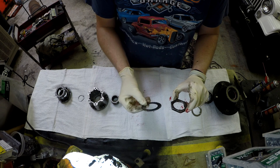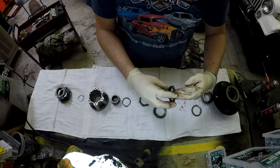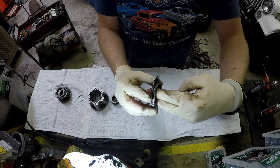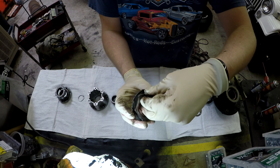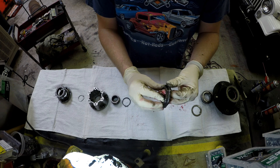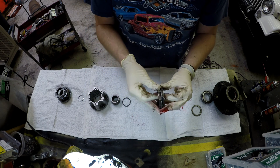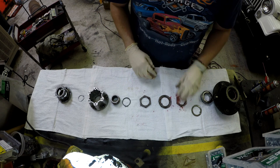Now when we look at this lock nut, we then have a locking ring and a second nut. We have lubricated components — this is going on over a threaded shaft — and then we place this ring on. With lubricated components, trying to keep tension on the nut is incredibly difficult. So what we do is place this lock ring between the two sets of nuts, and once the torque is where we want it, we take any blunt object that will fit and bend the side of that ring over the nut. Because that ring is indexed on the spindle by this little pokey bit here, it won't turn, and if a corner is bent over the nuts, they can't turn either. That ring is very important — it is what keeps the proper torque on the assembly after we've put it back together.